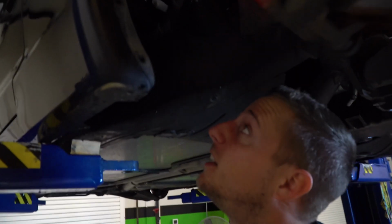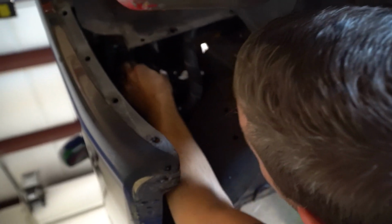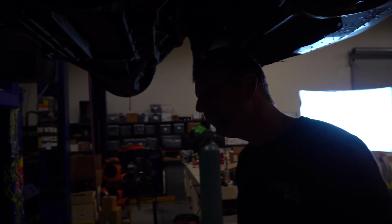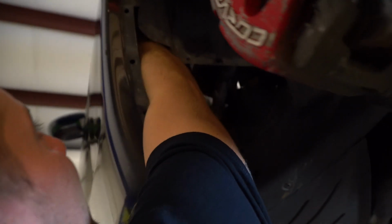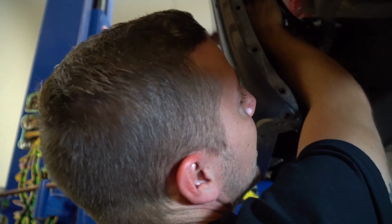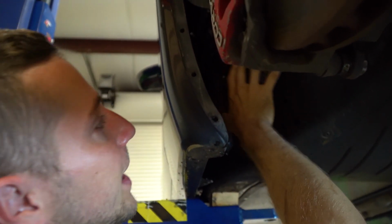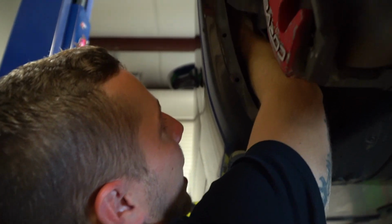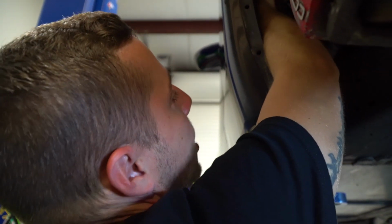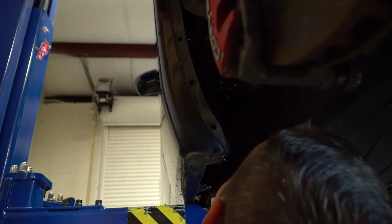The incredibly inconvenient ECU location on this car. It's right in there. But did they put it somewhere different in these years? No, it's right here. Tucked up higher? Yes, they just went up higher with it. It's about damn time. This ECU is way better than the 05-06 model that actually put the ECU right here. Then with angle kits and stuff, we end up moving them up higher anyway. So these ones are actually already up here, which makes our life that much easier. So we don't have to relocate the ECU, but we still do have to unplug it.